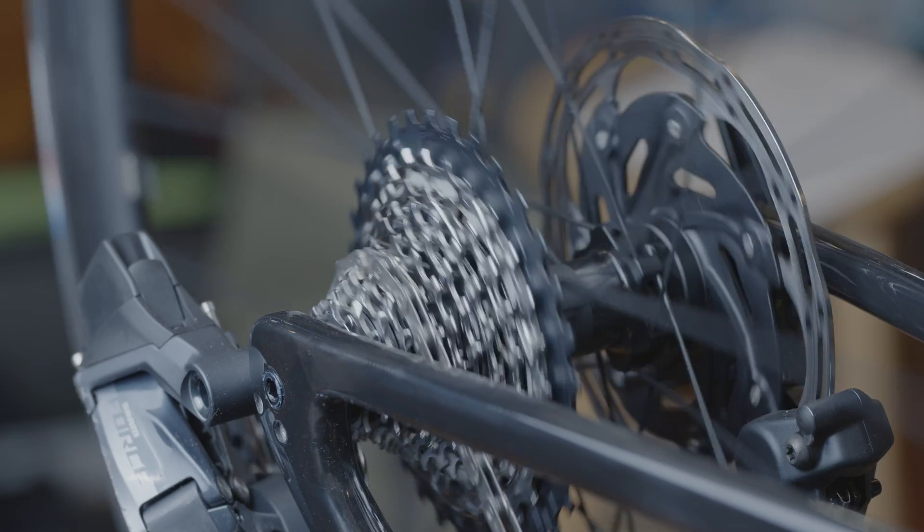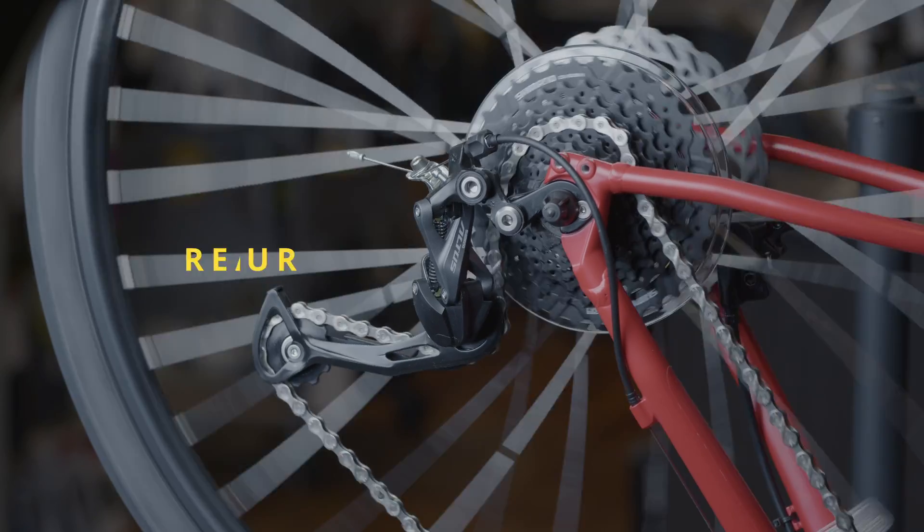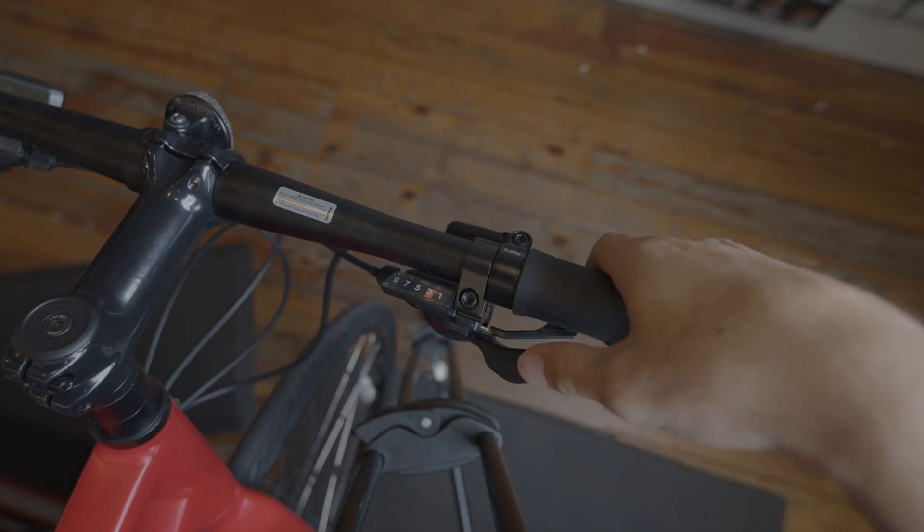You have different cogs for different gearing ratios. This is where your derailleurs come in handy. Typical bikes have two derailleurs, one in the front and one in the back. These are controlled by your shifters that pull and release cable, allowing you to shift into different gears for altering terrain.